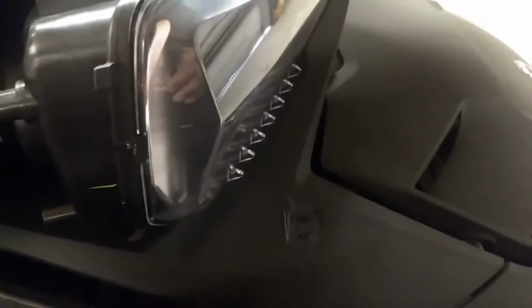In this shot, you can see where my dart pin has broken. I was doing some mods and it was really late at night, and I was just trying to get it completed, and I did not verify that when I snapped the panel back on, it was seated correctly, and I ended up breaking off one half of the dart clip. It can be called dart clip or dart pin, but if you're looking online to replace it, it's called the Can-Am Ryker dart pin. It has a part number of 293730080. I will put that information in the description box.